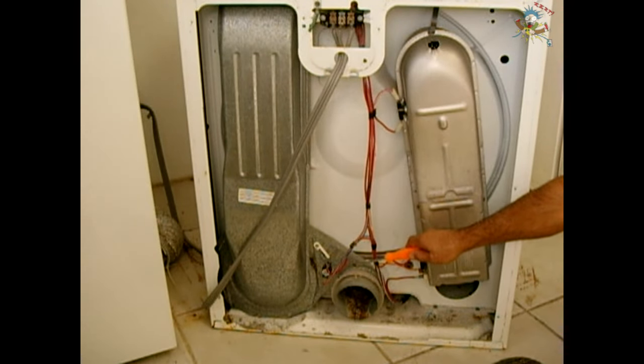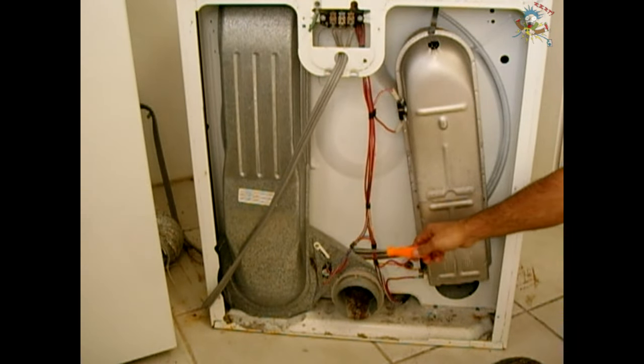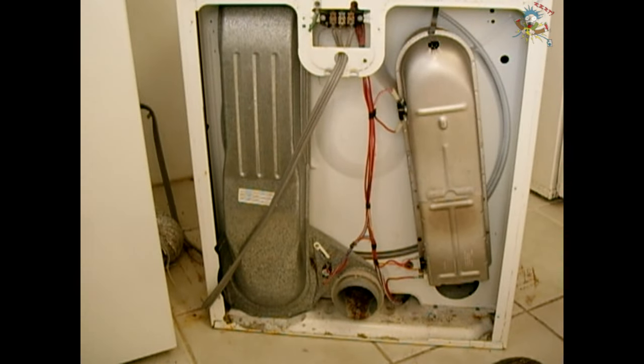Located at the bottom is an operating temperature thermostat, which we will test shortly. That white strip you see screwed into the metal housing is a thermal fuse — another safety feature. If the temperature rises too high, it will open the circuit and the dryer will no longer operate. But first, let's go up to the top, look at the timer control and the start button, and test both of them.